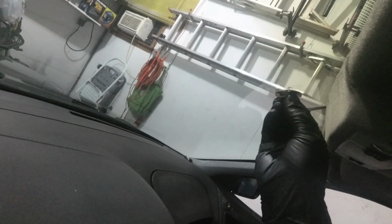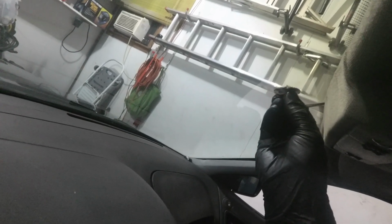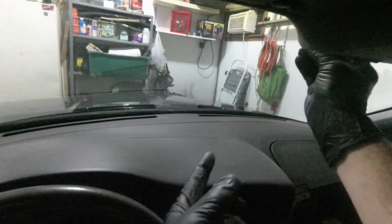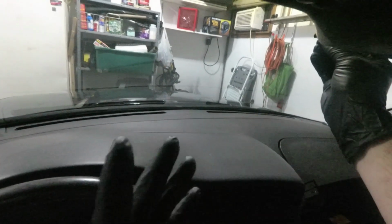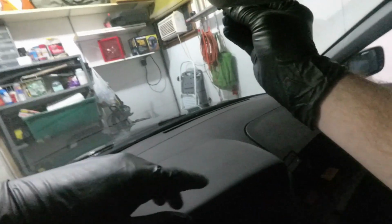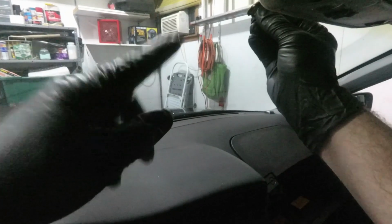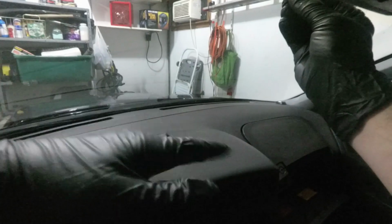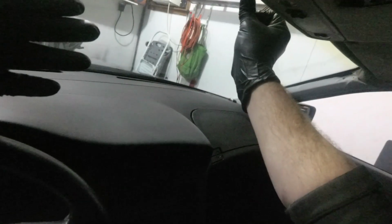If you're doing this and a piece of glass didn't actually stick to the button and give you a sweet little keyhole, then what you want to do is put the button onto your rear view mirror. So actually screw your rear view mirror on and then hold it up onto the windshield where you think it should be, and then just use something like a Sharpie or a wax pen or something that you can easily wipe off the glass later to leave yourself a little circle indicating where you need to actually glue the button. And then the second thing you need to make sure of is you want to make sure that you have the button upright so that when you put the mirror on, it's not upside down or tilted one way or the other.